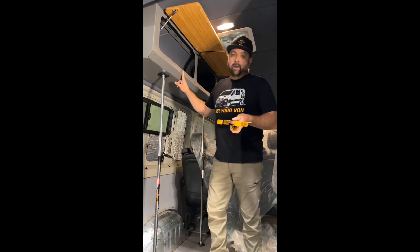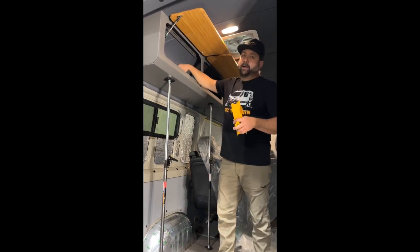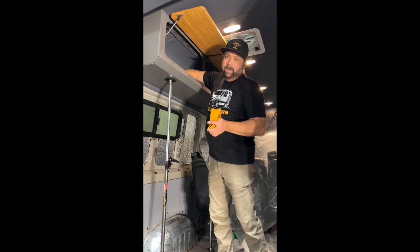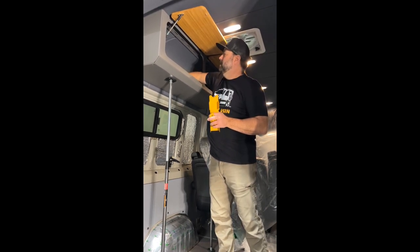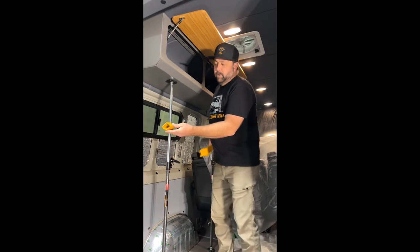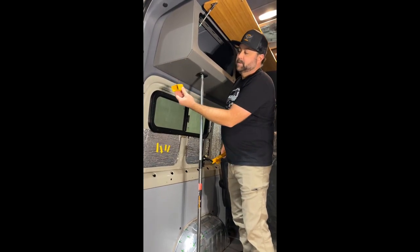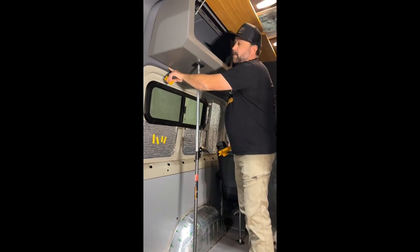Before we remove our cabinet, we're going to need to mark some places to drill. We're going to need to drill through the headliner with an eighth-inch drill bit — something small to get through the headliner material — and we're actually going to put a witness mark on the back steel. We're not going to drill all the way through the steel, but we will go through the headliner and through our slots in the cabinets. We'll make a mark on the horizontal beam in the back, and that's where we'll use the bracket that installs on the horizontal beam after the headliner is taken out.